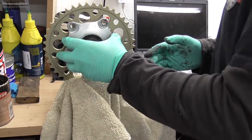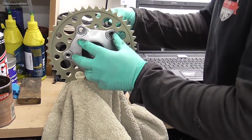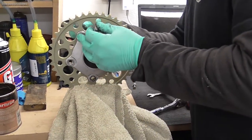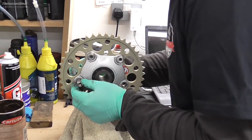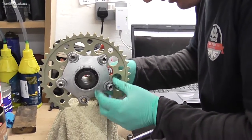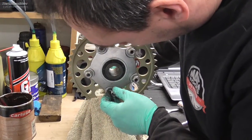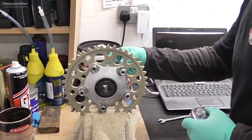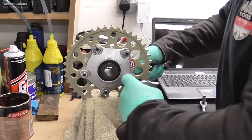What we need to do is just pop that in, line our holes up. Now these nuts that hold this on — according to the Aprilia service manual — could be used for up to three sprocket changes. As this bike's a low mileage bike there's no reason to suggest it's had more than three sprocket changes. There's also a special order for doing these bolts up. So what we're going to do is just run these bolts up a little bit, just snug them up — I'm not going to do them fully tight, just nip them up, and then I'll show you the order.